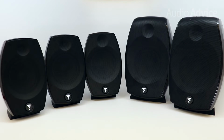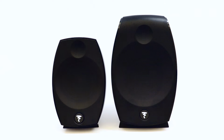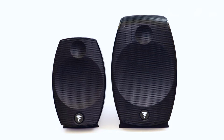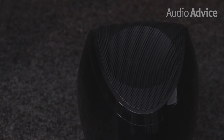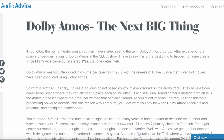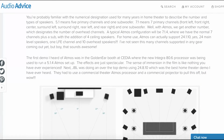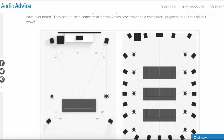The 5 satellite speakers each have a 5-inch Polyflex woofer and a 3/4-inch soft dome tweeter. You'll notice the main left and right satellites are larger than the other 3. This is because they also have a 4-inch full-range Dolby Atmos speaker in the top of the cabinet that fires up at an angle. If you're not familiar with Dolby Atmos, we have some great information on audioadvice.com that can get you up to speed. We'll put a link in the description for you.